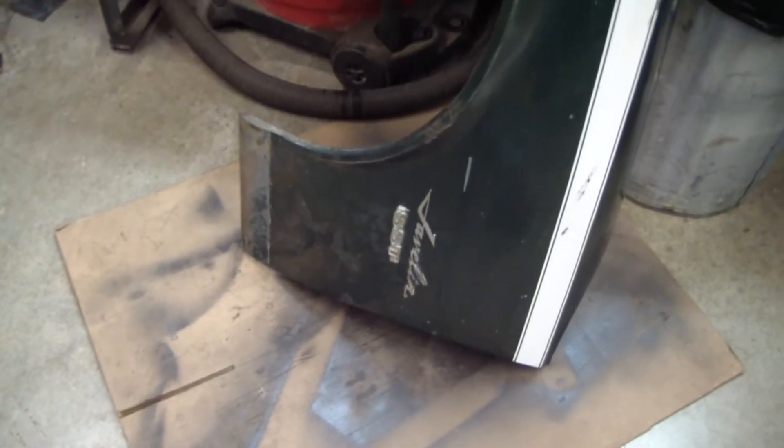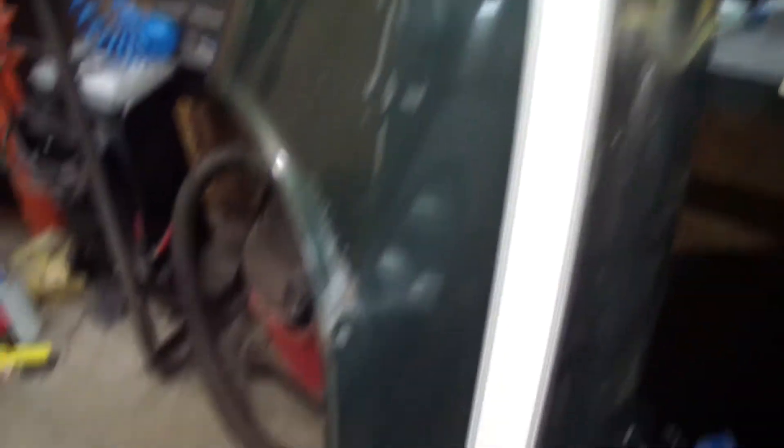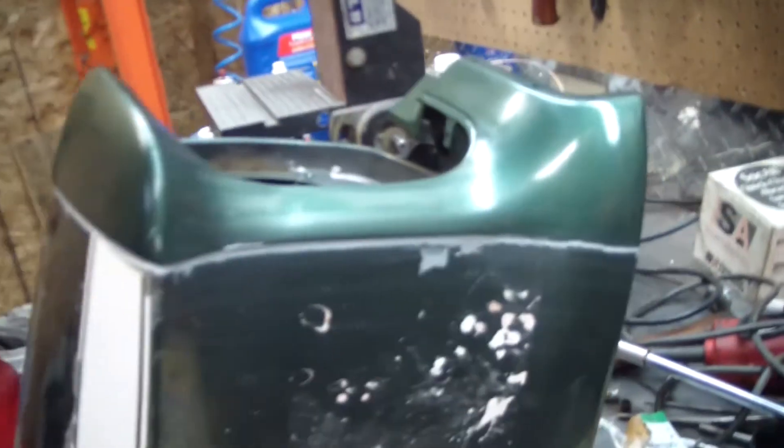Here's the Javelin door bolted back on — got that working like a champ. Here's the driver's side fender. I went ahead and put that Javelin emblem on it. And here's a dent dollied out somewhat straight. This fender is looking kind of rough but still rust free. Got the fender extension bolted on with some seam sealer and I'm letting it dry.